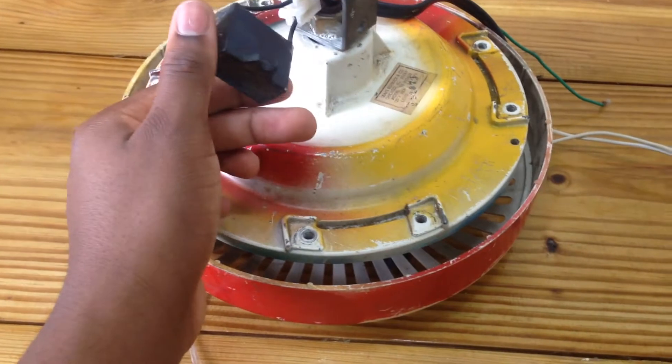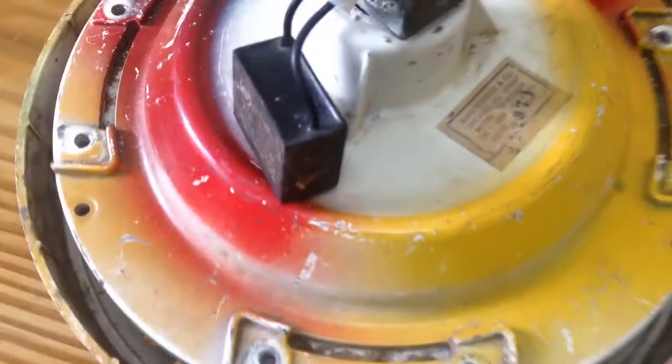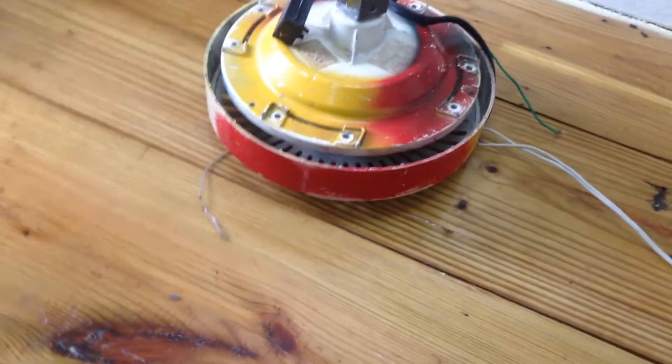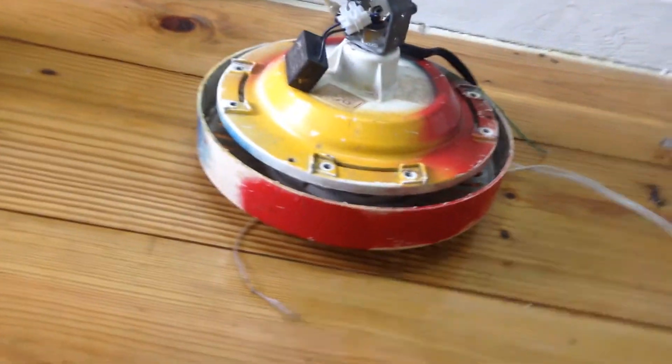This capacitor is just a test one. I'm going to need to put a proper capacitor on this — don't know what the original one was. It's a good thing the stickers were preserved because these were very close to getting painted over. So it's a good thing these are still here, because it was these I used to figure out how to rewire it, since it uses different wiring. I think this model of fan was released in 1980-something.